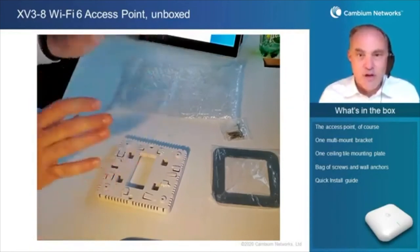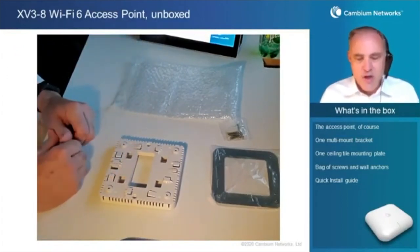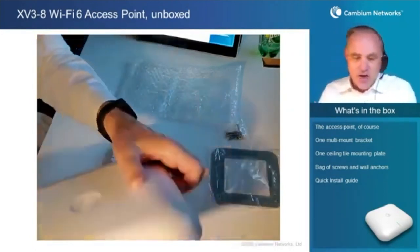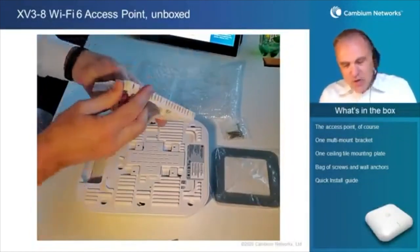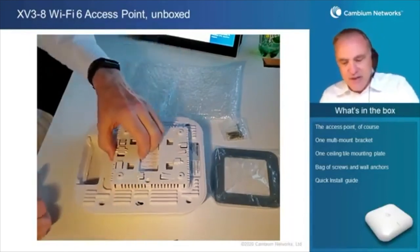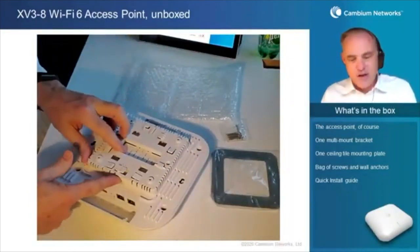Here's the part you're really going to love. If you've ever been standing up on a ladder trying to snap the access point on and it just doesn't want to secure and it's hard to do, you're going to love this new bracket. It snaps on very easily and securely, and does not come off without using a screwdriver. So let me show you that right now. Flip the AP over — we have the latch right here, which aligns with the latch on the mounting system, and we have these four slots. We just line up the access point to the slots and snap it into place. Nice and strong, not going anywhere. You won't be able to take it off without using a screwdriver to insert inside the slot and remove the bracket.